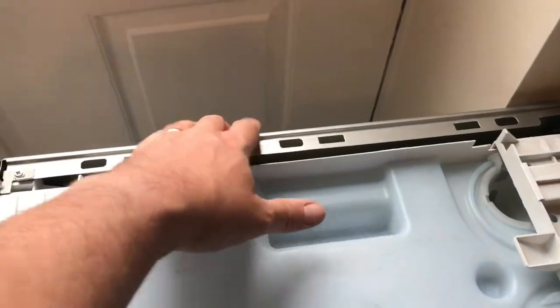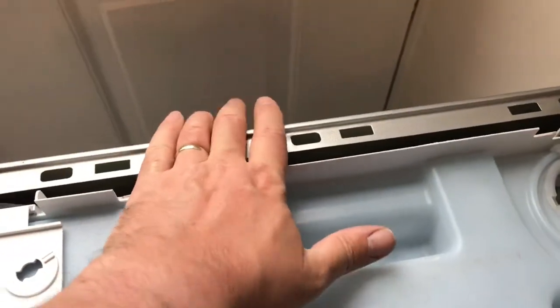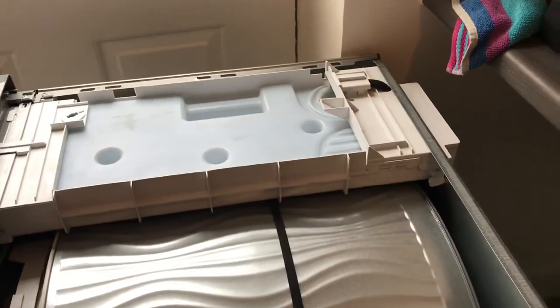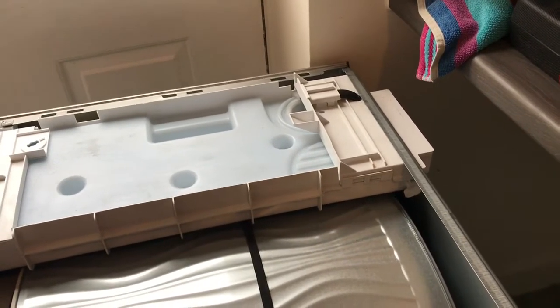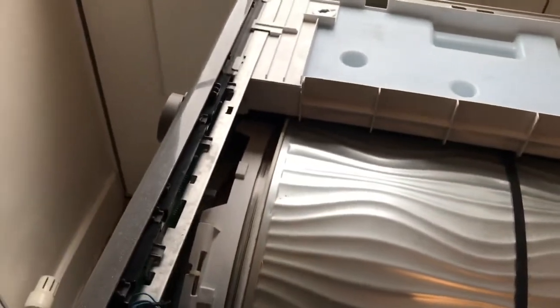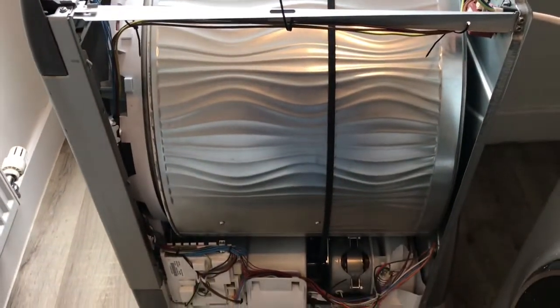This side on already. So what we need to do is remember to locate the side correctly, and I'll show you that in a second. Then you'll have a screw to fit on here, which holds it in the front, and then you'll have 4 screws which run down the back. There are more than 4 holes in the back, so you'll need to make sure you get the right ones, because the other holes, if you put the screw into it, it should just sit in and it won't screw into anything, so you'll know it's the wrong hole. So just make sure you locate the right holes. So then I'll go and get this side of the panel, and we'll put that one on, show you how to locate it, and go from there.